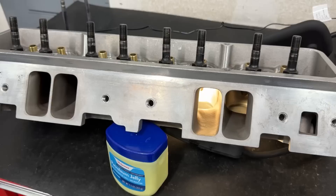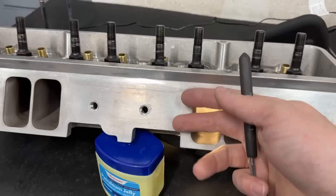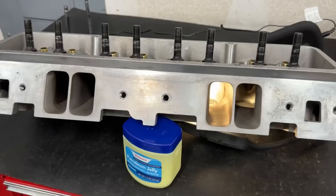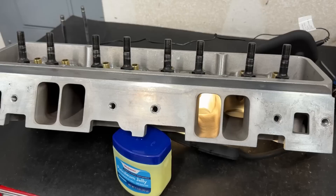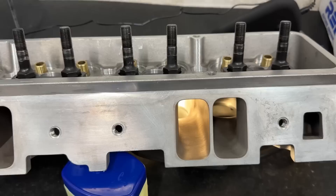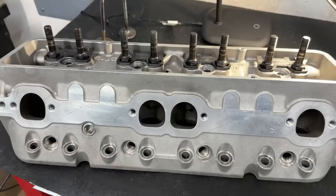Not all intakes will port properly, so sometimes they're shifted and won't line up. Also, a brand new intake manifold flange could be warped as much as six thousandths — the gasket will take some of that up, but when the divider is already this thin and you've got six thousandths of warp, it's going to push the gasket out. Trust me, I've milled enough intake flanges to tell you it absolutely happens. But if you can get it right and get the intake matched, you're going to be golden.